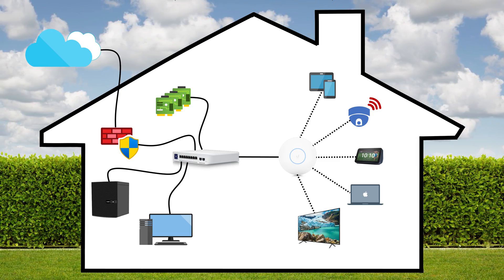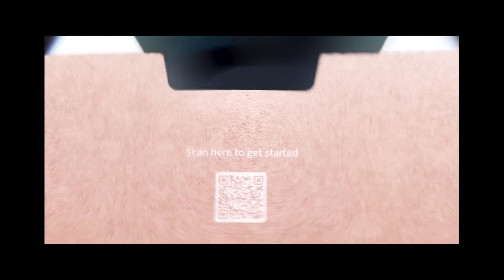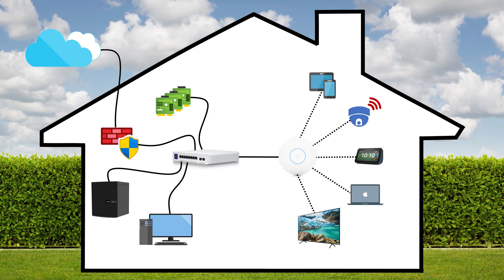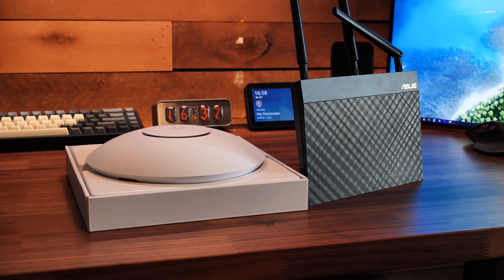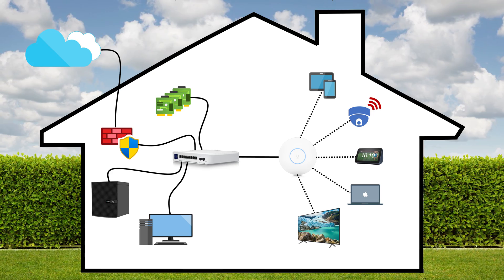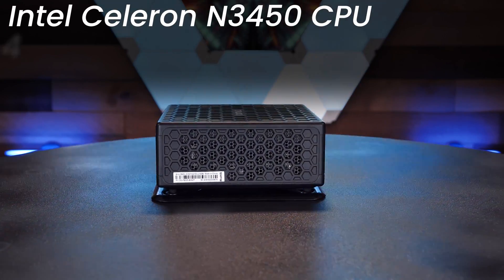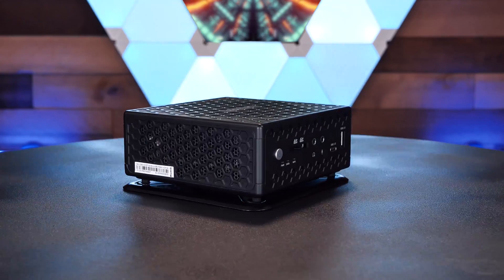This build is actually going to be pretty simple. The new network will center around the Ubiquiti UniFi USW Enterprise 8 PoE switch that we reviewed recently — check out that video if you haven't seen it. The USW Enterprise 8 PoE will only be doing Layer 2 switching and for right now, just be configured with a single VLAN. Off the switch, we'll be installing a Ubiquiti UniFi Wi-Fi 6LR AP. I also have a new PFSense firewall that we built a few videos back to serve as my edge protection from the internet, as well as having an IPsec tunnel connected back to the studio for transferring data securely between my home editing office and the studio's main redundant storage.